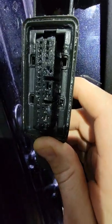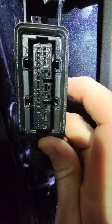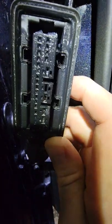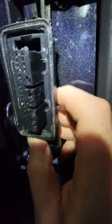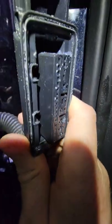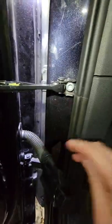Okay, let's have a look in the door harness side. So again, you see the dielectric grease. Again, I put it around the rubber seal as well because it created a very, very airtight or suction-tight stick. I did not clobber it all over the connector, and it's very, very little amount overall. But anyway, it locked the connector in there very tight.